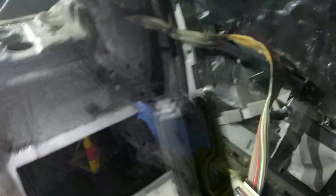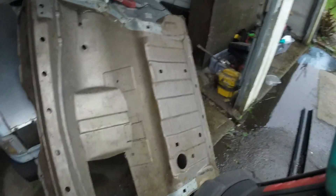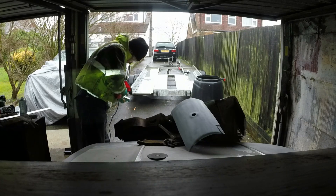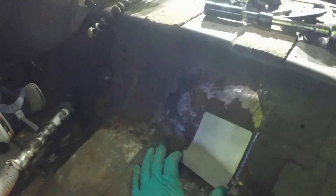That bit is being frustrating. I'm now going to do that bit - that hole is a little bit on the optimistic size, meaning there's probably less metal there than I need. Basically - I'm getting tired - bigger bit, that is what I was trying to explain. So I'm going to chop that out, do what I did last time, clean it up, cover it in zinc paint and get ready to weld it in. That bit will go on there when that's dry - I'll come back, trace around it, chop that bit out neater.